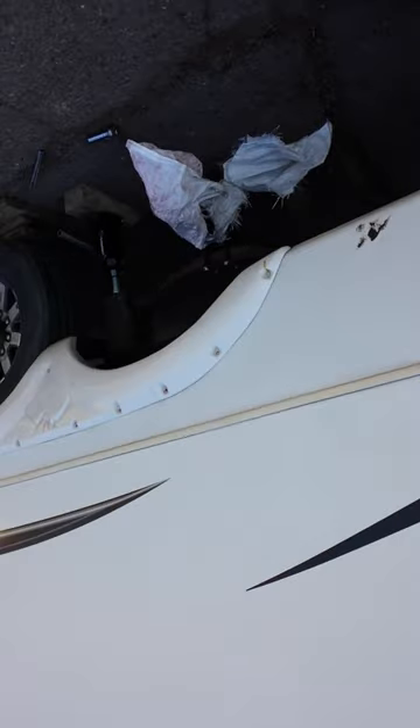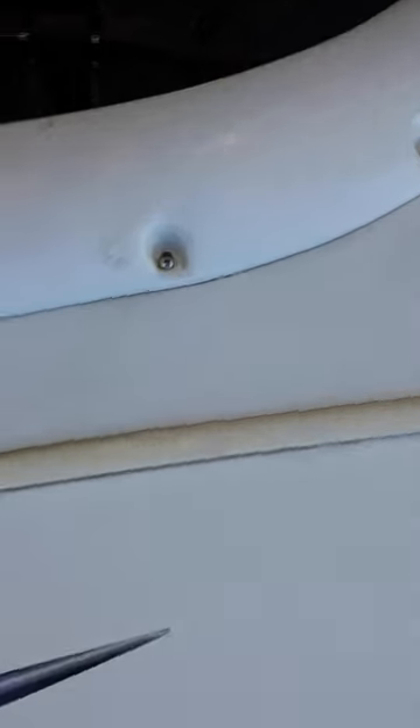I took this little cutter right there, cut the old bolts off, it dropped down, put this one up. I did this by myself — saved me a thousand bucks. This is engineering; that's one reason you buy something good to start with. There's no alignment to them — they've got pins. There's a pin right here on these shackles. I cut the old U-bolts off and put the new U-bolts on. There's a pin at the bottom of the spring there — it just slipped right up on there. Put a little loop on it, slipped right up. What a simple job.